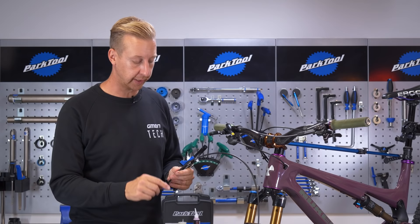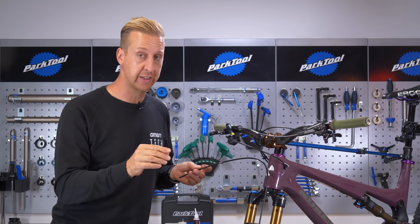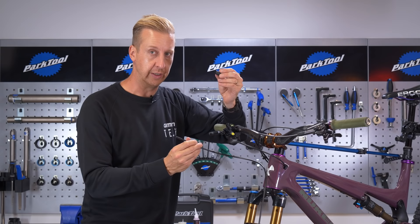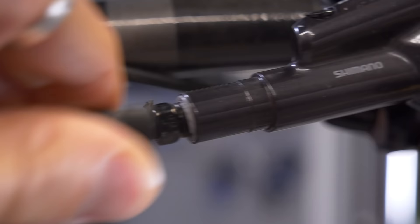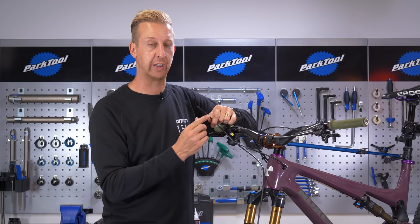If you don't have one of these dedicated hose cutters, you'll need to remove the caliper from the bike and do this in a vise using the cable clamp. Something important to note: this will be slightly different depending on the brake manufacturer. On the end of the hose there will be an insert — I can't reuse that, so when I trim this I'll need to reinstall a new insert. The order of assembly is critical: the little rubber sheath goes on first, then the threaded nut and the olive together, and finally the insert goes inside the hose. Make sure you get the order correct — you can't get the rubber sheath on afterwards if you've already put the nut and olive on.